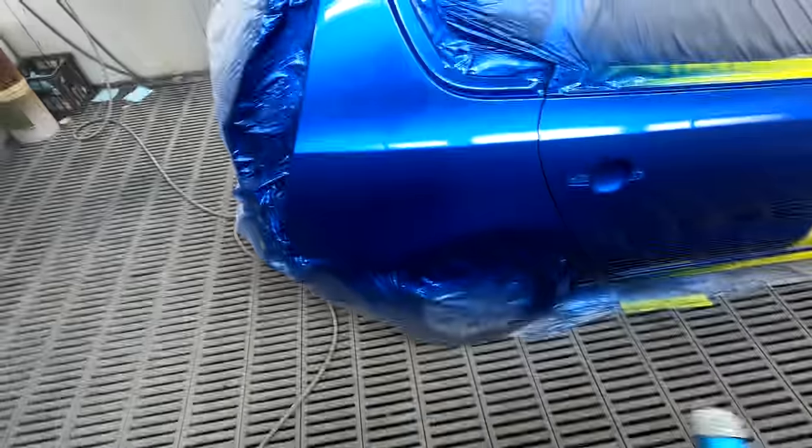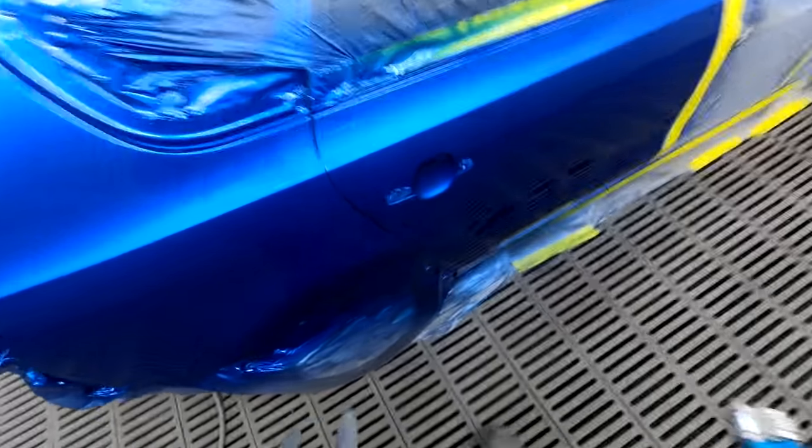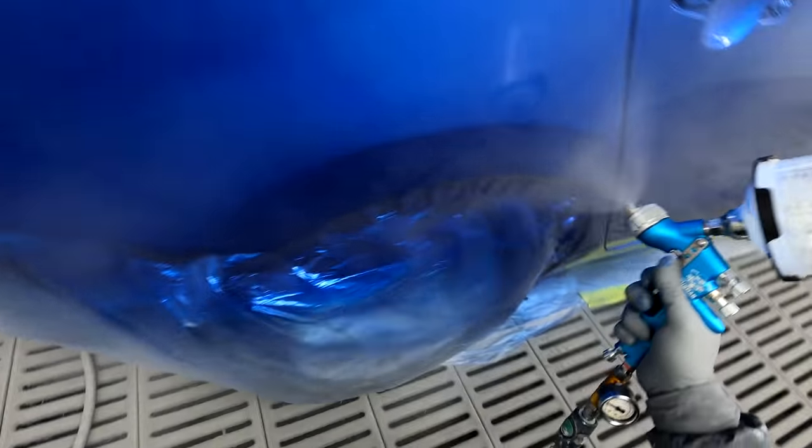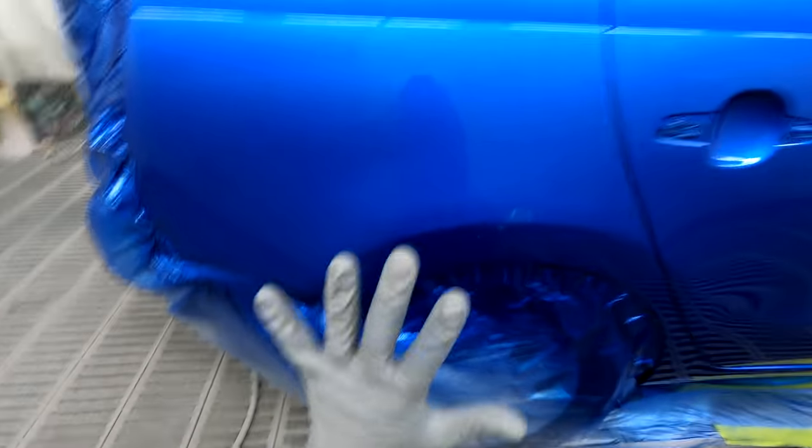It's a very tight finish — there are actually a few little pinholes there, we'll try to fill them up. But this gun wants to lay down really flat and tight. The distance between the highs and lows is very close. There are a few little pinholes — sometimes that happens when you put the Standox base coat down too wet, which is probably what I did because it looked like it was drying. But that's filled them up, so I'm going to give that a good five minutes, take my respirator off, go get the camera, take some photos for the insurance company, and let that flash right off before we smash another coat down. I mixed up 400ml and we should just have enough.